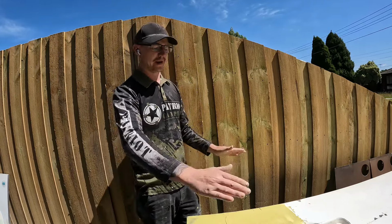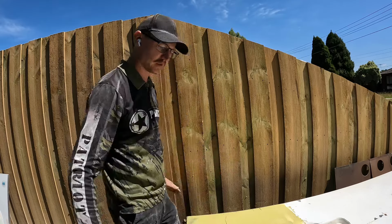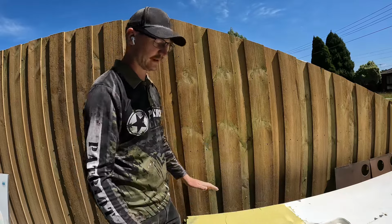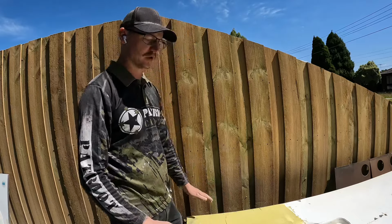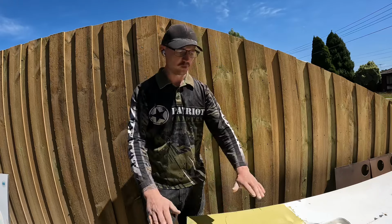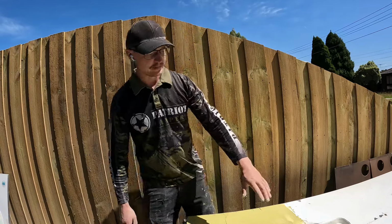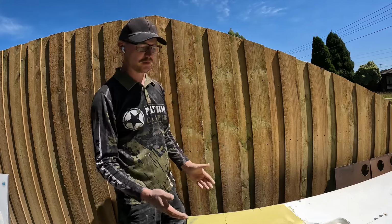You want to go out past the extent of the repair, so you want to bring it out to where it's nice and smooth and there's no dents, so that when you block it all, it is all even and flat. Now, as I said, nine times out of 10 you won't always get the repair first go when you skim it, so just get it in there nice and tight so it's nice and easy. Sand all that off, and then if you've got to add some more, you can later on. It's pretty straightforward. Obviously there's still heaps more of this dent that we've got to fix up, but you can't mix too much filler at a time.